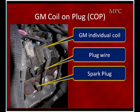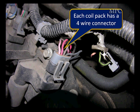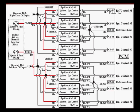We have all the same issues as before — spark plugs that can develop carbon track, which happens with any ignition system. This particular system has four wires. Here's the complete schematic with all eight cylinders: two different injector and ignition fuses, each supplying four coils and four fuel injectors. By connecting into that pink wire or injector A fuse, we could get ignition current waveforms for those four coils and four injectors all at the same time.